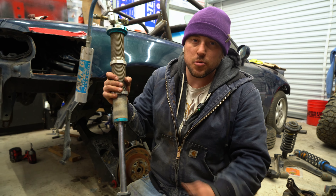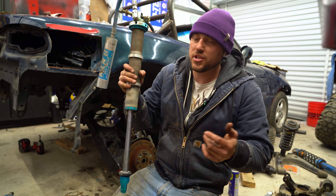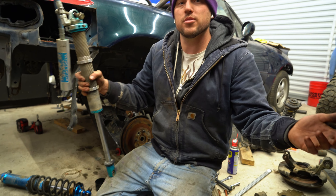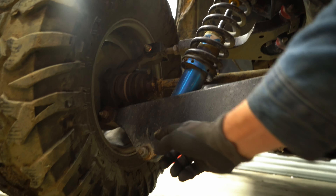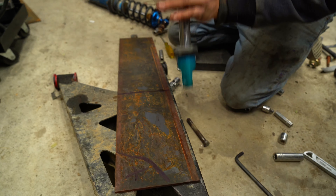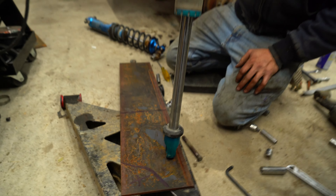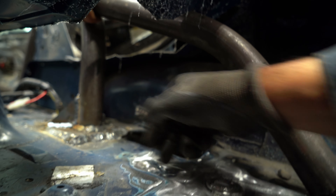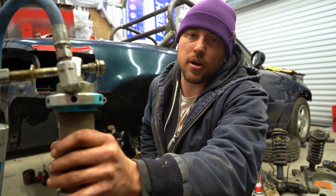In order to use these shocks, we need to raise our mounting point, which does two things: one, allows us to use the whole travel; two, we won't scrape things on the lowest point of the car, which was literally the shock mount. We are going to cut out a piece of steel, make a new shock mount there, make a shock hoop. The shock will mount right around here, go down through here. Then we have a pretty official pre-runner suspension.